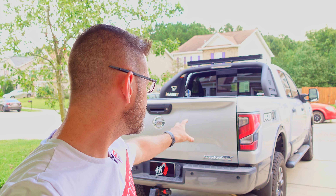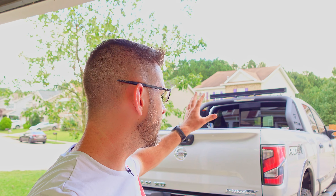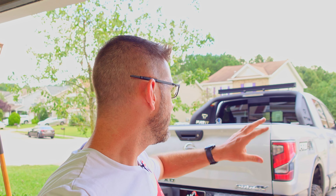That is the installation for the Nissan Titan Accessory Anchor all-aluminum tailgate bushing — CNC machined, perfect fit for the Nissan Titan. The hardest part of this job is getting the old one off. If yours is already cracked — which a lot of these are, he said he's already sold 2,000 of these so obviously this is a big issue — it'll probably come right off, or may have already disintegrated. My truck has about 50,000 miles on it and I did have to use a Dremel to cut it in half to get it off. Everything else went flawless — the tailgate is really easy to remove and not too bad to put back. The whole thing can be done in literally just a few minutes.